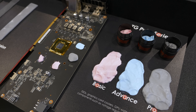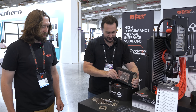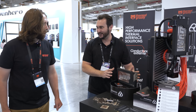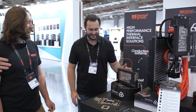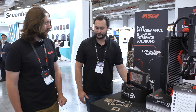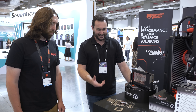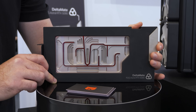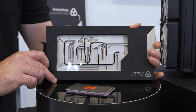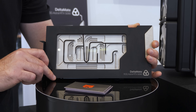Can I pick that up? It's just the cable. Wow, that's up there with the heaviest 5090 I've picked up — I'm scared putting that down. It's very slightly lighter than the air cooler of the Astral, but not much. The Astral being so much physically larger, you expect it to be heavy, but this being so compact is surprisingly heavy. That's largely due to the water block. By far the heaviest component, the most complex and the longest to produce is this cold plate. This gets machined from both sides, and then the entire thing is glass-blasted, then machined again.